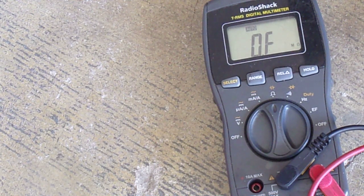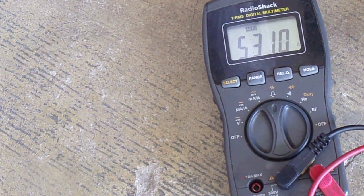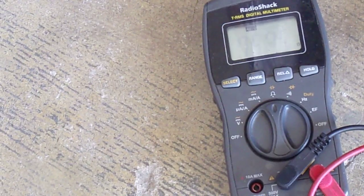The only other thing I can think of is this wire is right by the distributor. I wonder if there's a proximity issue here, you know, with the spark maybe. I'm going to need to route it differently. I don't know. There. Did it move around much? Yeah, it's still jumping around. I don't understand that. That is bizarre. Okay, well, let me just try moving it.